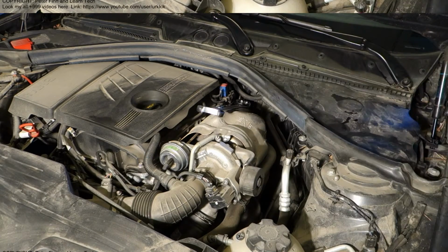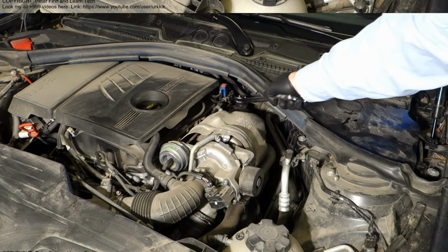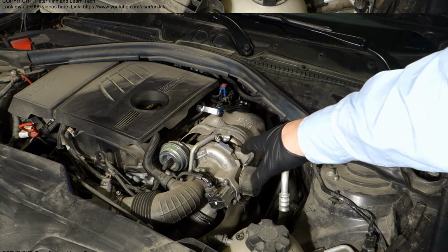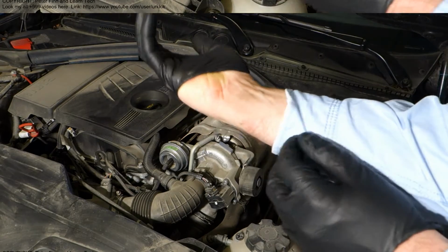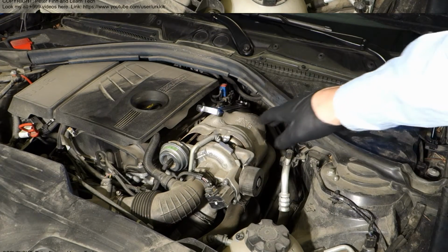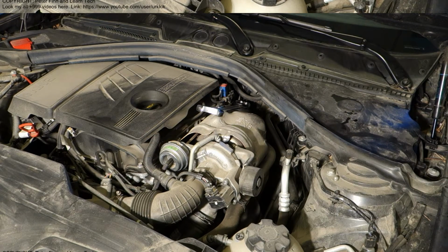Okay, and there is our position where I am planning to install my big and long wrench, and it is this bolt that I need to open next. And when I am planning to replace that, remember that this turbocharger is extremely hot, and be careful that you don't hurt yourself, because I already hurt myself. There is this red area on my skin because I touched this cover area. And this is really hot because I drove about 5 minutes ago, something like 20 miles. And this turbo stays very hot for about 2 hours.